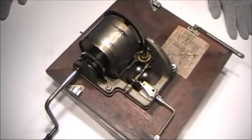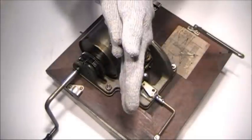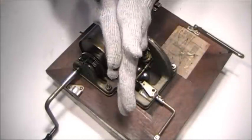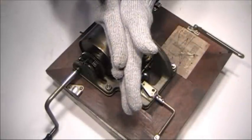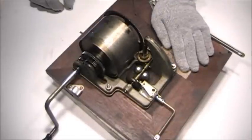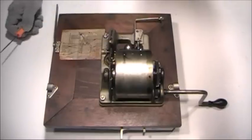After 100 years, that mixture has turned sticky. The springs need to be able to glide against one another as the motor winds down. With the stickiness, the springs get stuck, the motor keeps running, and eventually the grease gives way to the power of the spring, so it lets go all at once. That is the thumping that you hear inside of your Victrola as it winds down.